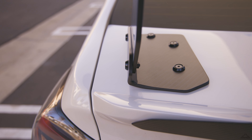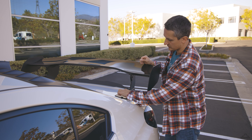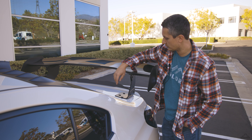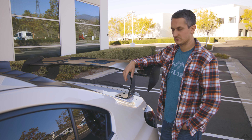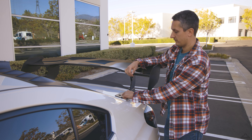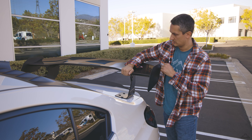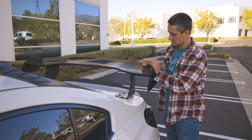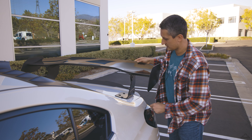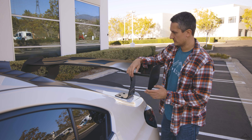The whole thing is super strong - there's zero flex. The wing is bolted to the trunk with three bolts, these are stainless bolts painted black, and the washers are also aluminum. Initially I was just planning to use two holes for the wing, but I realized the wing had a little bit too much wobble due to the trunk being so thin. I found a third location and drilled it, and that made all the difference - side to side there's no flex, and back and forth there's also zero flex.